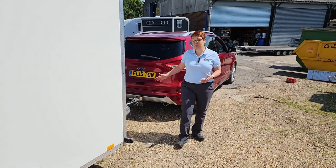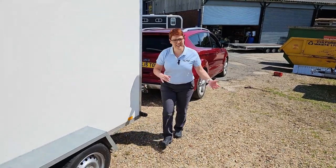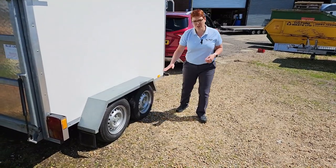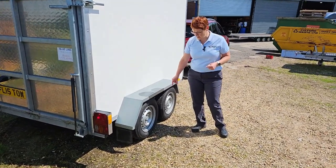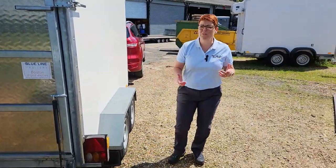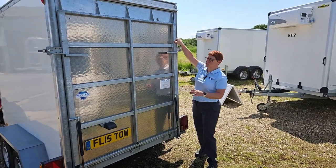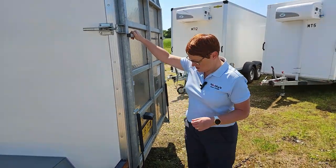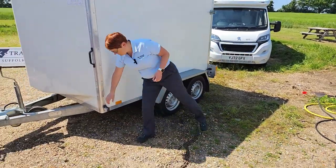We've coupled up and we're happy with that, so now we're going to do a trailer check. All that involves is walking around and making sure anything attached onto the trailer — your extra lights, mud guards, wheel, mud flaps, handles etc. — are actually attached. For the tyres we're checking torque settings on the wheel nuts and making sure we've got the recommended legal tread depth. Also check the age of your tyres — there will be a date of manufacture on there, and the recommended lifespan is between five and seven years. Carry on round checking lights are attached, doors are secure, and that you've got a matching number plate. Repeat the same checks down the other side: all tyres, wheel nuts, reflectors, handles.